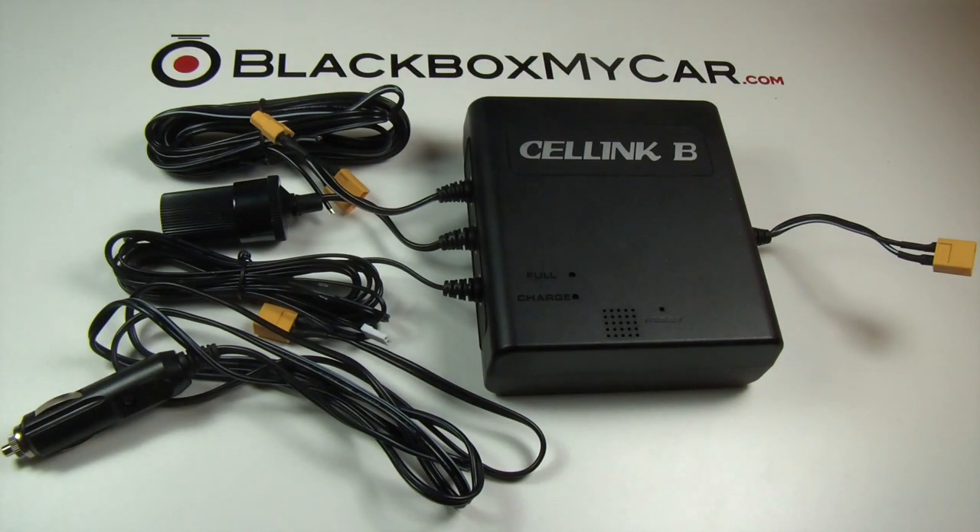This isn't just a BMW issue — it applies to any car: Toyota, Hyundai, Mercedes, Porsches, Lamborghinis. If you rely on your car battery to power your dash cam while parked, you're putting significant stress on it. In colder areas, that stress increases and your battery might need replacing every two years instead of four or five. With the Lucas or T-Power Plus Alpha, you're still drawing from the car battery until it drops to a certain voltage before switching to the dedicated pack.